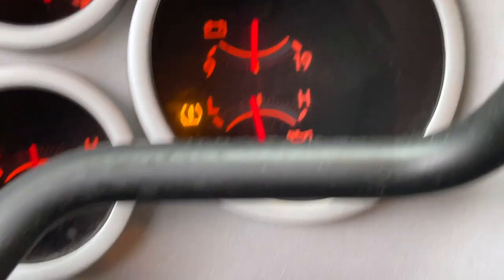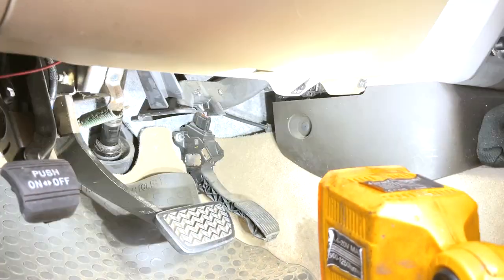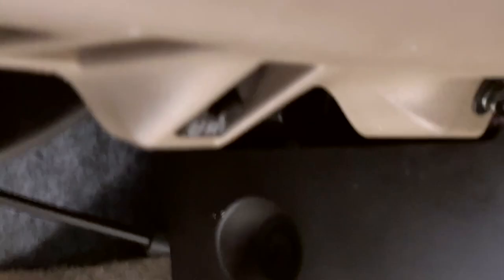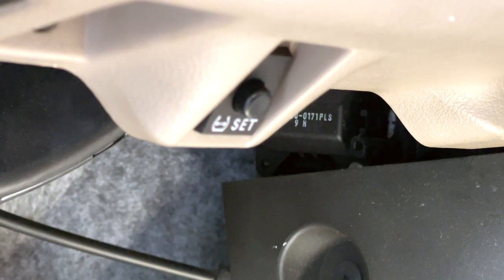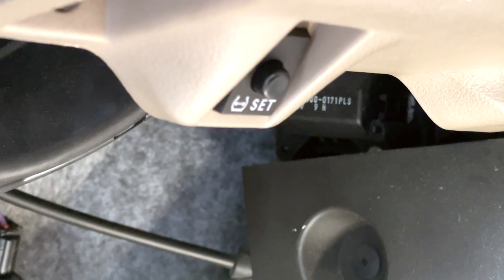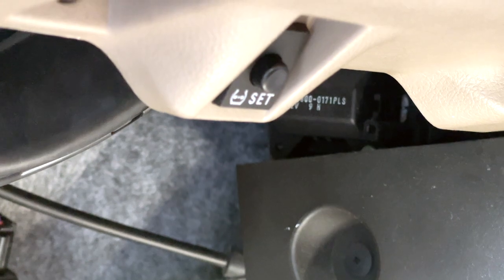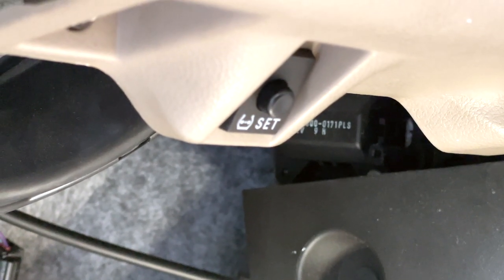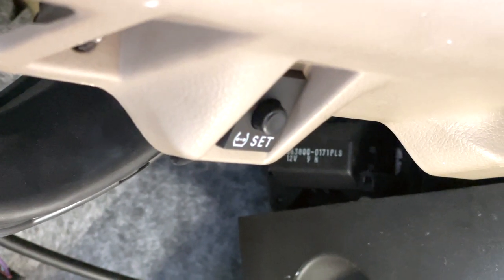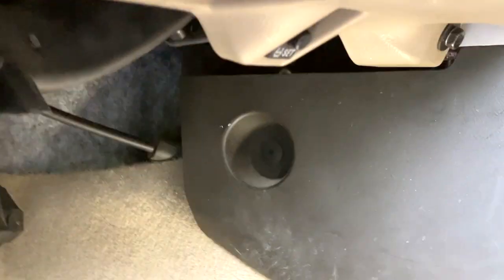The word on the street for this one - it's a 2007 Toyota Tundra 4.7 liter - the reset button is underneath here. If you don't have an OBD reader, you can use this reset button. I read on tundra.org forums: just hold this button for six seconds, then turn the car on, let it warm up for three minutes, and it should reset itself. If not, we'll find alternatives including disabling the TPMS - interesting for those who bought aftermarket rims.